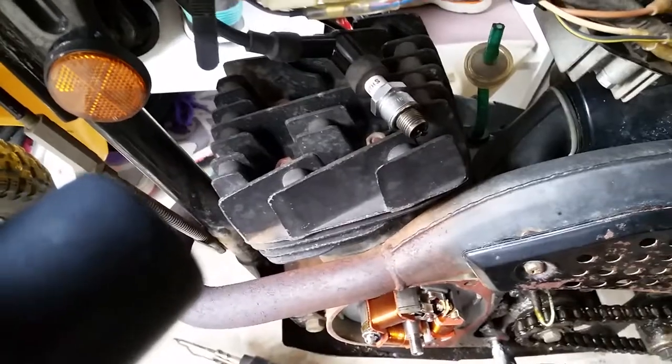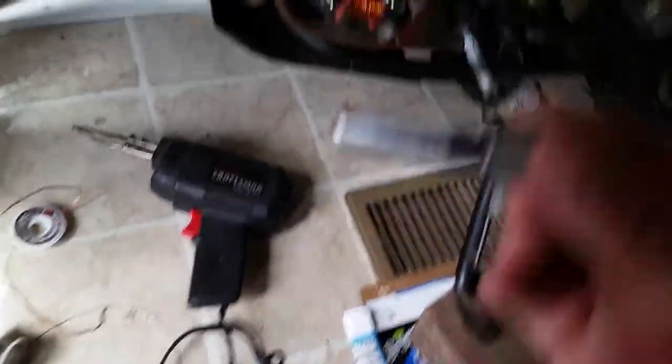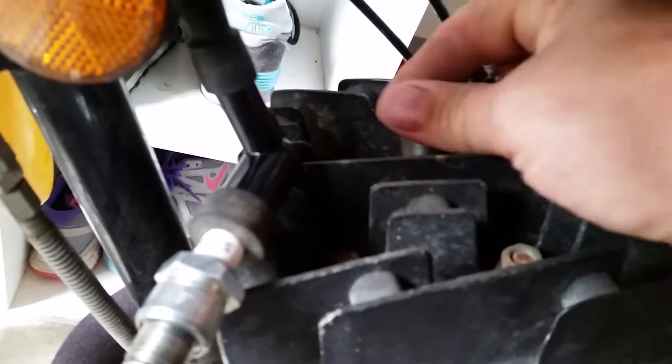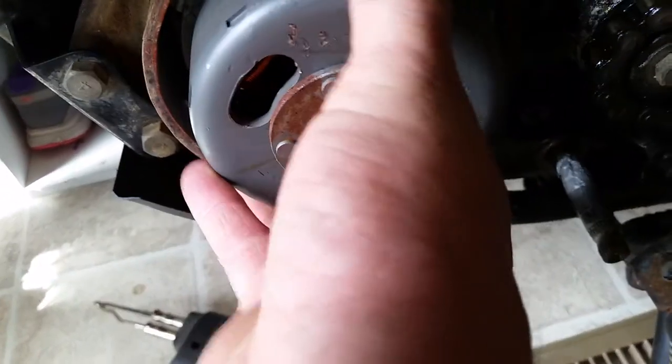Also, with the spark plug, check the gap before you put it back together. They make these pretty cool tools — this right here is a piston stop. This screws into where the spark plug goes — just hand-tighten it, you don't need pliers. Once you get that all the way in, make sure you don't lose your flywheel key. Slide your flywheel on until it fits in, snug.